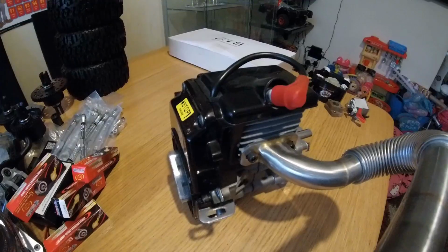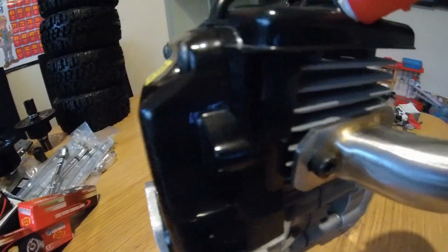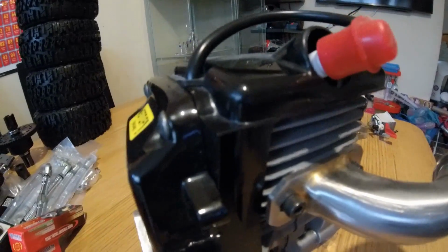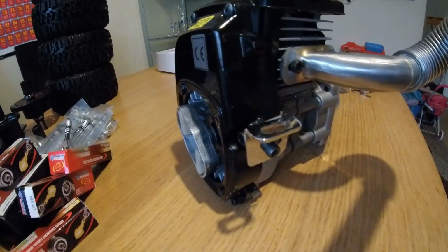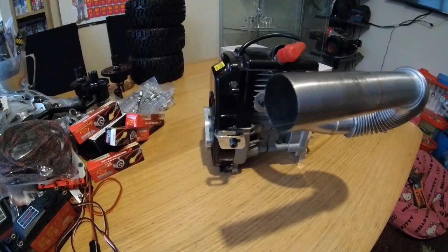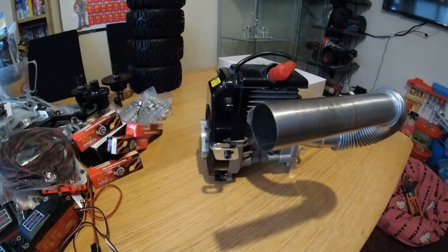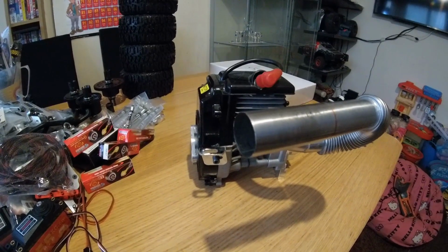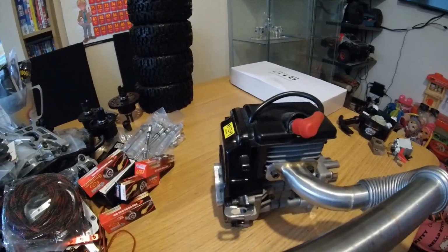It's the perfect size, brother. It's a millimeter off from the exhaust port and the exhaust manifold. So I can go in there manually, grind that down, and it'll be perfect. There'll be no distortions in the flow, hopefully. This header is for the engine number DLE 111 or a DA 120. I'm not familiar with airplane engines.